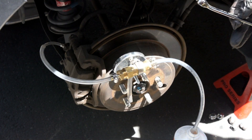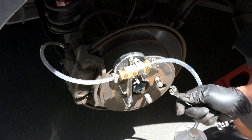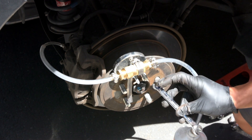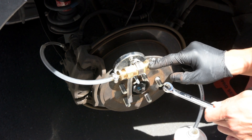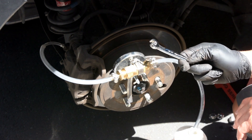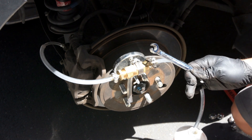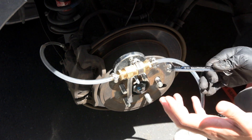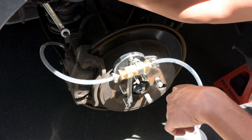I'm going to use what they call a flare wrench - it's a little different from your typical wrench. They're designed for working on soft fittings. Where a regular C-wrench opens on one side, the flare wrench comes around the nut an additional amount, so it gets a better hold and you can't strip it. I know this because I've stripped brass fittings before. Before you do any brake work, make sure you have a set of flare wrenches - you don't necessarily need them for the bleeder valves, but I use them anyway because I don't want to strip them.